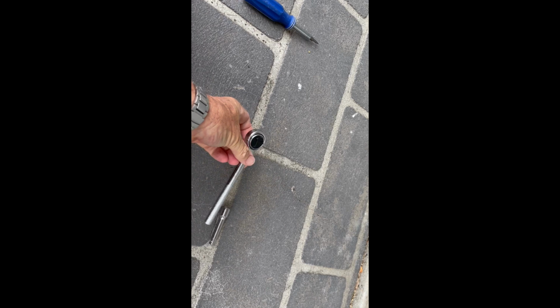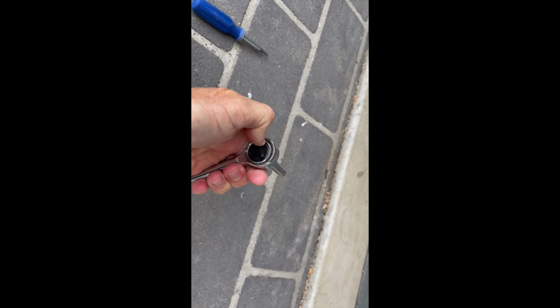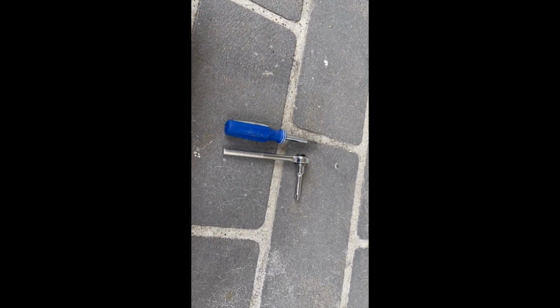And the second tool is a socket wrench with the little extension piece, a 3/8 size. So that little square is 3/8 of an inch. We pop that onto the end of the socket. We'll be rotating anti-clockwise, which will wind the awning in. So you just set it so that the ratchet takes the strain in an anti-clockwise direction. And that will bring our awning back in manually.